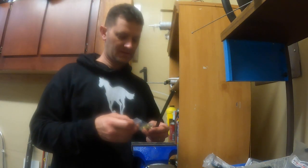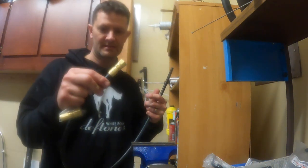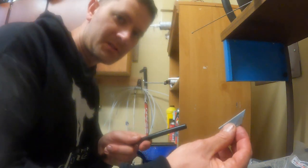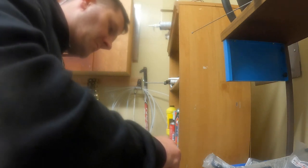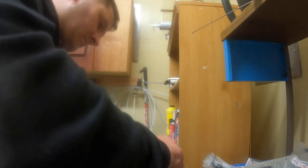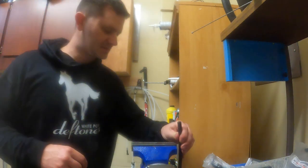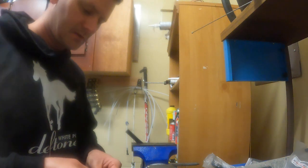So I never used or even built hydraulic lines before, for that matter, but I did one, and I'll show you how I did this. Actually, once I figured it out, it wasn't that hard. First thing I did was I took a razor blade and just made a nice even cut across the hose. All right. Now I put this in this vise to be able to hold it, because it was just not best controlled by me holding it.